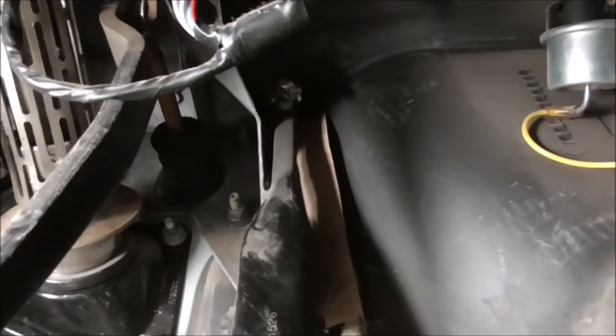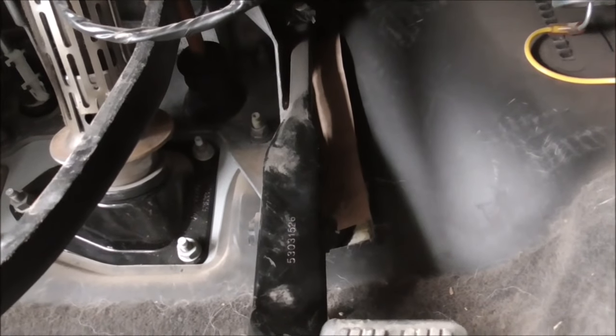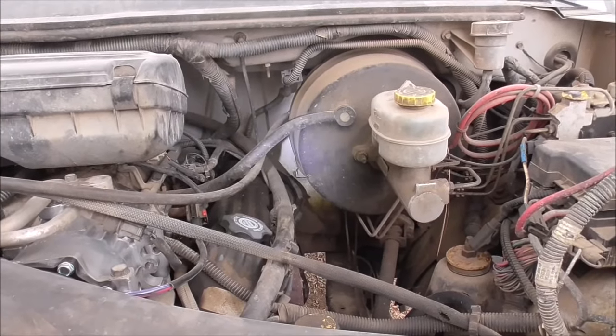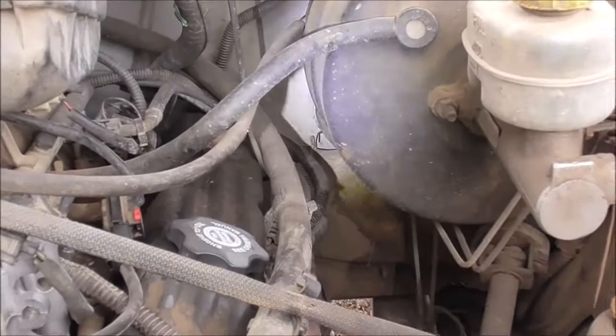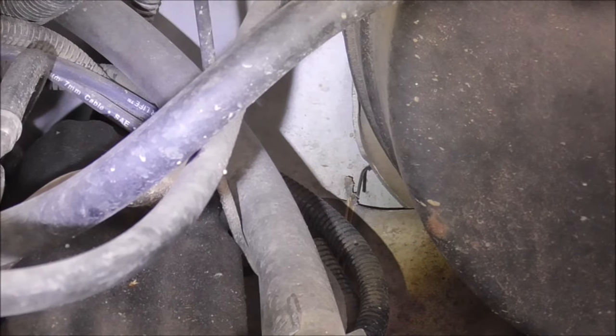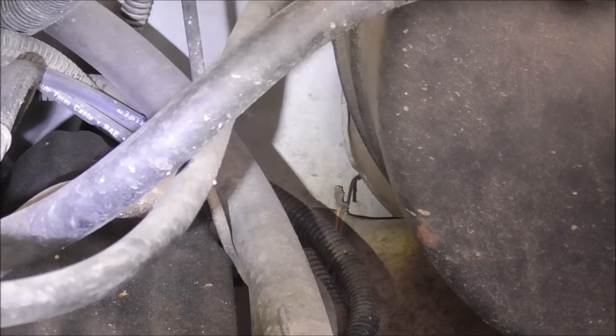There's the paper template right there next to the gas pedal lever — it's pretty close to it but I guess there's enough room. So I'll drill a hole and hope I don't hit anything important. The instructions said if I drilled too far to the passenger side I'd hit that support — well, oops. I poked a test hole through there; I can come quite a bit more toward the passenger side. I hit something on the driver's side, so I'll try this again.